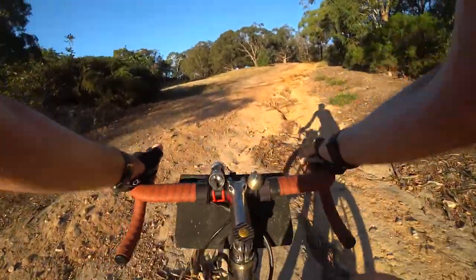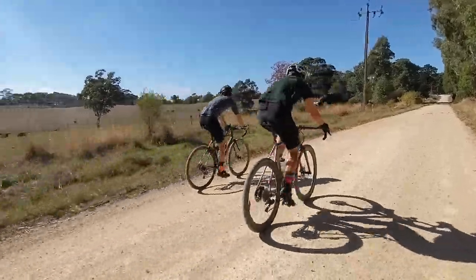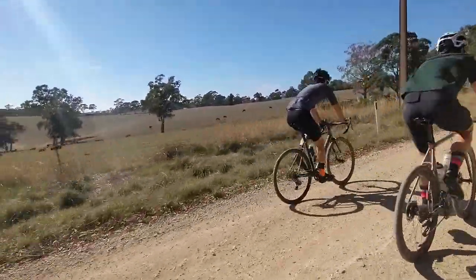There's no escaping that wide, heavily treaded mountain bike tires are going to roll a little bit slower, particularly on smoother tarmac where the tread pattern does just slow things down. Mountain bike tires really come into their own the bumpier your riding is, and at the opposite end of the spectrum, if your riding is mostly smooth you're not really gonna get any of the gains. To be perfectly fair, a really fast-rolling mountain bike tire will out-roll a slow-rolling gravel tire every day of the week — I'm just talking more in general terms. And finally there is weight, and this is something I try to tell gravel riders not to worry about too much, but you can't escape the fact that a lot of mountain bike tires are quite heavy — though there is a very good reason for that.